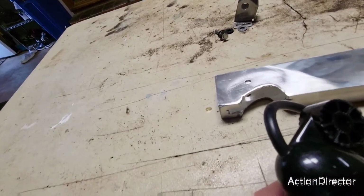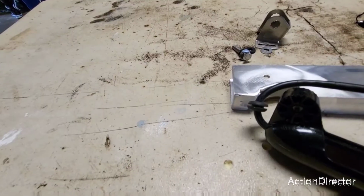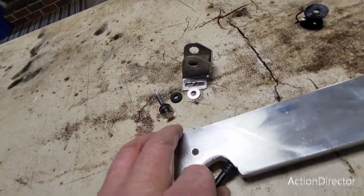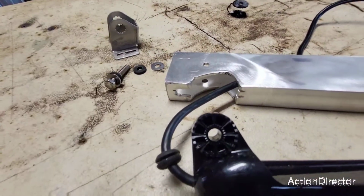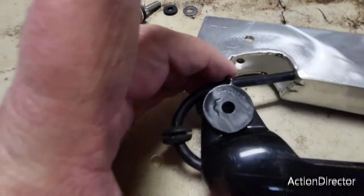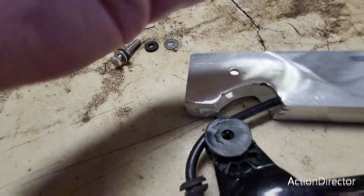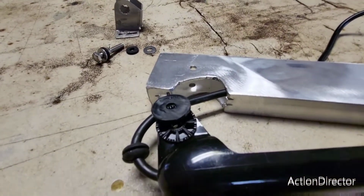So for assembly, the first thing you're going to want to do is put on the first rubber grommet right up here so it's already in place. Alright, now that I have that grommet on, I want to fish this wire right up through here and just pull it all through. You want to get it all in there. Now that I have my wire fished all the way up in there, this is where it becomes kind of tricky, because you have to insert this in the slot, and you also want to make sure that you have this piece here, so when it goes up in there and pinches in, your cable stay, which is integrated into this plastic piece, will help keep the cable curving right around and staying inside the channel. So let me go ahead and get that fished up in there and at the very least get my bolt started.